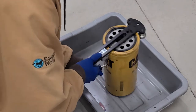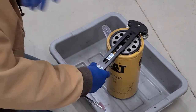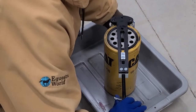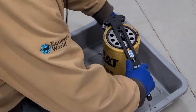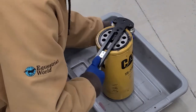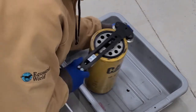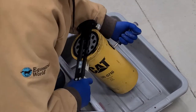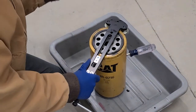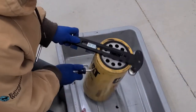I'm really interested to see what's in here because when I bought my seven-ton it had a little oil pressure issue. The pressure wasn't nearly as much as I thought it should be — it was okay but a little low. At idle after it warmed up it would sit around 25 or 30, but when it was cold it would be at 50, which is a good pressure.